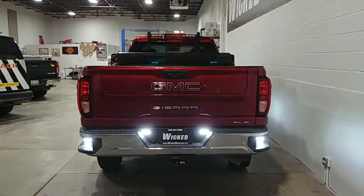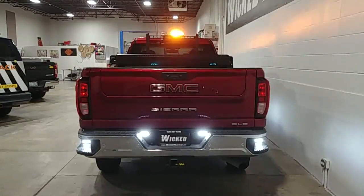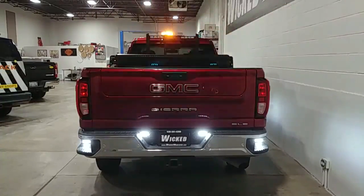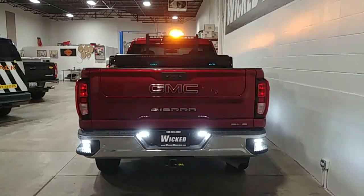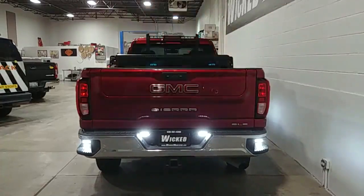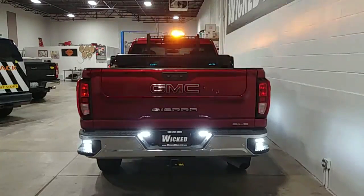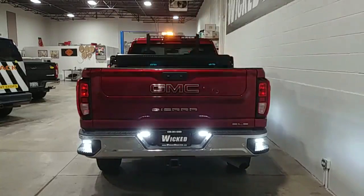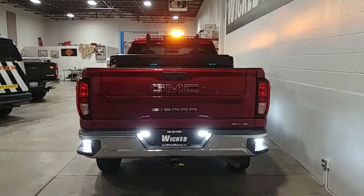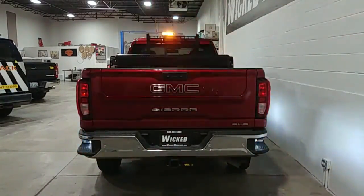Taking you around the back of the truck with the camera still up pretty high so you can see that light bar — you'll see our 3-inch amber-white SoundOff M-Power. We mounted that horizontally right by the rear license plate, as well as horizontally far into the step pocket. I like to mount that light horizontally in the outer step pockets. You can use the SoundOff M-Power, a TIR-3, or a LIN-6 — we use those quite often. A LIN-8 will fit there as well. It's just a great spot to put a light because very rarely do you get your foot all the way in where you're going to damage that light way in the front. When we turn off the flood, we return back to our warning. We went with a more aggressive pattern on all four of those M-Powers in the back.